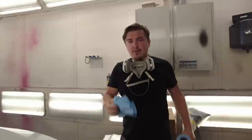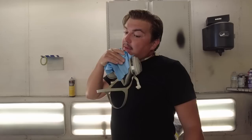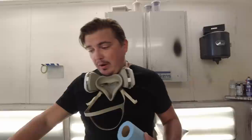Paul, explain to us what the sealer is for. So the sealer helps seal any primer or any minor imperfection that you have, that we have a nice smooth surface whenever your base coat lays down. Factory comes with a sealer. A lot of people don't.